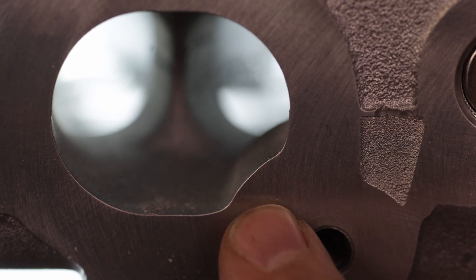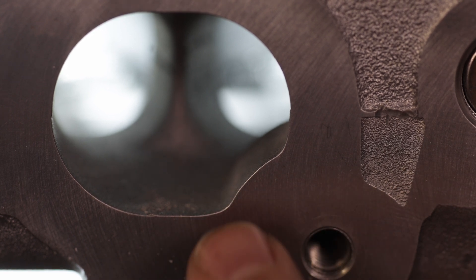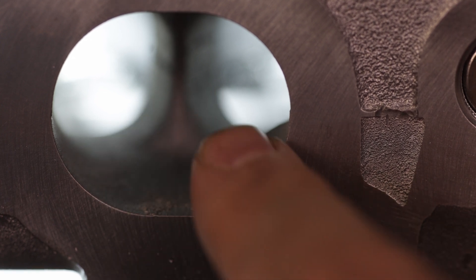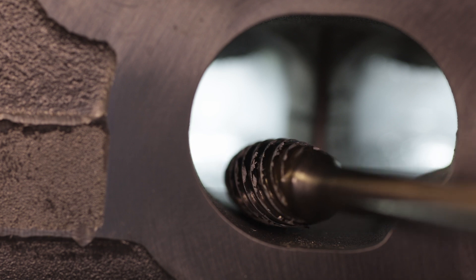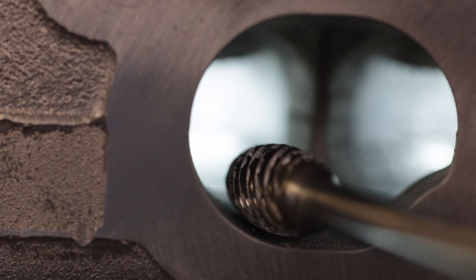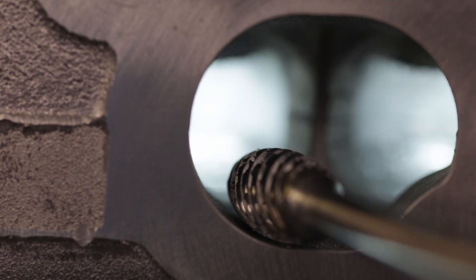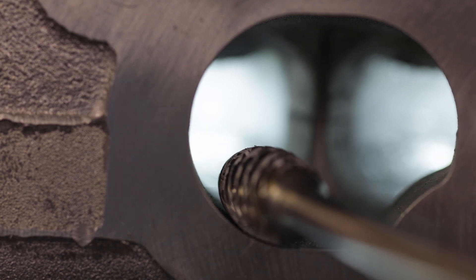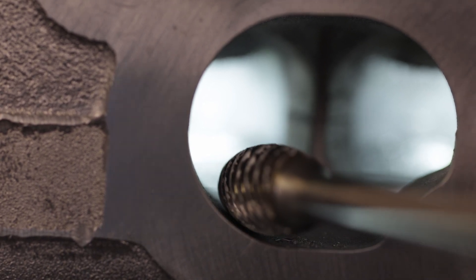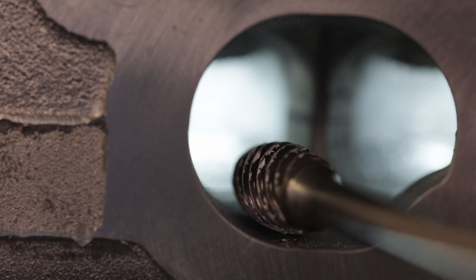We're not using an OEM header, so I would just rip this thing out so they're all the same. It's made for the OEM header because it's a twin turbo, and this basically makes the exhaust gas go towards the header design. Now let me show you something about shapes. Here is a half-inch burr — it really doesn't follow the shape of the port. You can see it's half a circle. A lot of guys try to make this shape and either square it or round it. A half-inch is okay here, but you still kind of have to make the shape, and if you mess this up it's a problem.